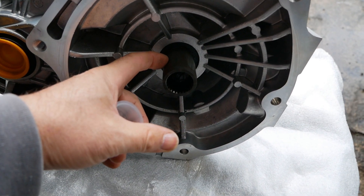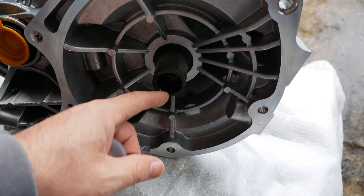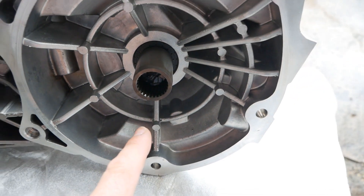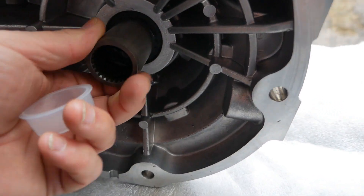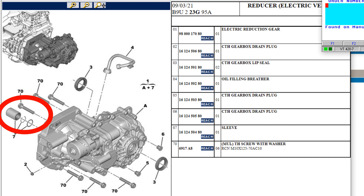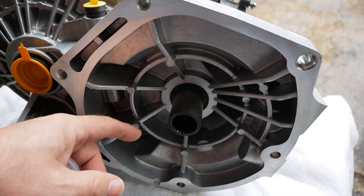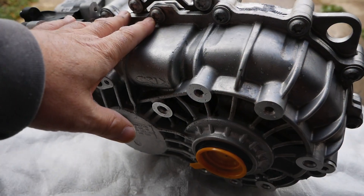There is a sleeve that joins these two shafts together, and this is also a weak point — we've had one customer where this has failed, and I've been contacted by someone else where theirs has also failed. I think it's just because of the torque put on here from the electric motor. You can see there are splines there — the motor shaft slides in and the sleeve goes over this. I'll show a diagram on screen — it's £75. It basically joins the two shafts together, and that sleeve can fail. I've only heard of two examples so it's not a common issue, but at least that sleeve is available as a part — you don't have to buy a whole new gearbox. I just wish the actuator was available as a part as well.